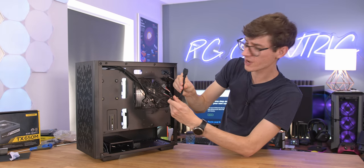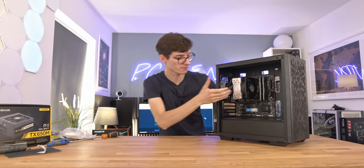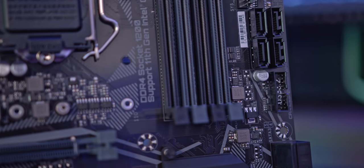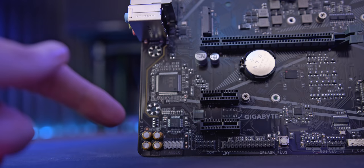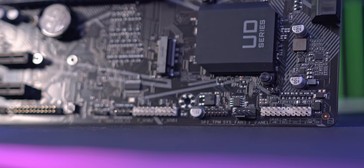The next step is to plug all of the front panel cables in — we've got USB 3, USB 2, HD audio, HDD LED, and power switch. These are what make the front panel work and all of them need to be connected to your motherboard. Route them through the hole nearest the socket you want to plug into. Feed the USB 3 cable through and plug it just below the SATA ports. The USB 2.0 goes right down at the bottom into the little white ports. HD audio is also white and is all the way at the bottom left. The tiny front panel connectors for the buttons go to the block at the bottom right — your motherboard manual will tell you exactly where to put them.